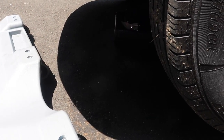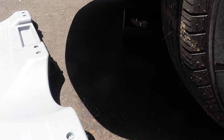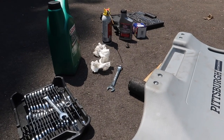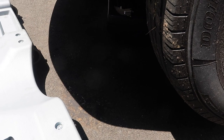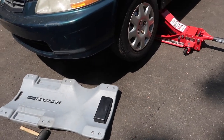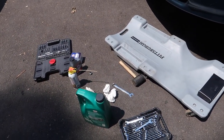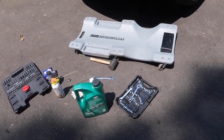The oil came out black as hell, so it's definitely been a while since the last oil change. Getting fresh oil now — putting all five quarts in. I went heavier with 10W40 instead of the called-for 5W30, and I'm gonna put the additive in to make sure she runs smooth. I like Castrol GTX — ran it on my Maxima when I was a kid.